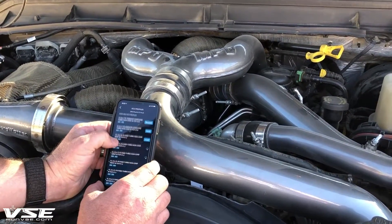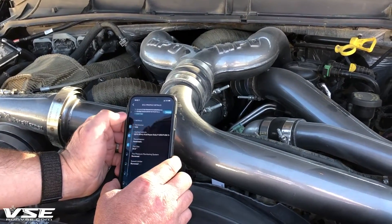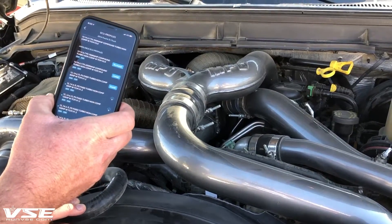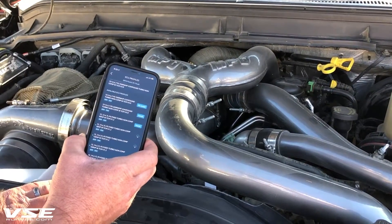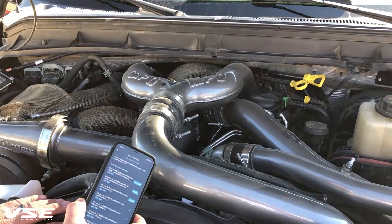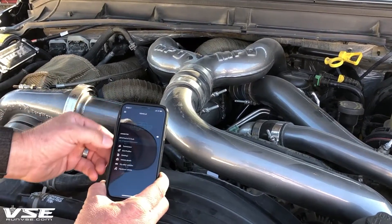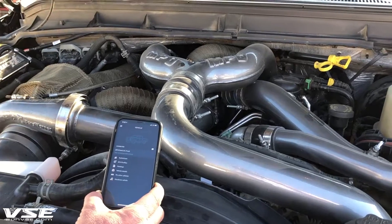This is for fixed-vane turbos. We have tunes for single turbos, for 2015 turbochargers, and for compound turbocharger setups like what we have in this truck now. There are tons of options. This is a cloud-based app that pulls data from the web, downloads it into the EasyLink box, and imports it into the vehicle's engine control unit and transmission controller via the OBD2 plug. The EasyLink is installed into the truck and it takes about three minutes to flash both engine and transmission. Users can pick the tunes they want, and if they have multiple trucks hooked to one EasyLink box, they can select different trucks and install tunes using one EasyLink device.